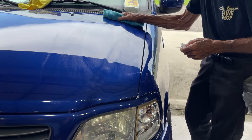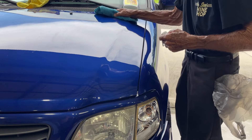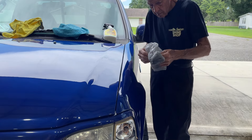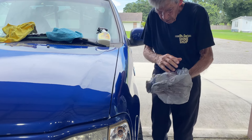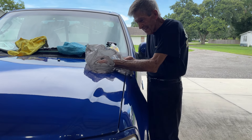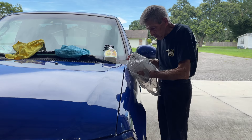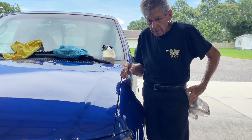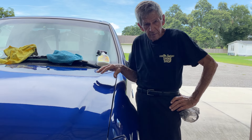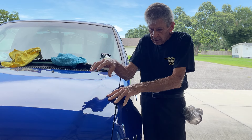With that done, you've got your bag — and everybody's got two or three of these things laying around. You can't feel it there with me, but the contaminants are gone, and that's what you want. Depending on whether you're going to put a spray wax, cream wax, or ceramic coating on it, you want that surface down to the clear coat because the treatments you're putting on it need to adhere to the clear coat.